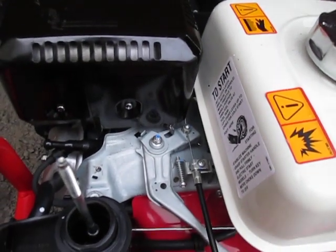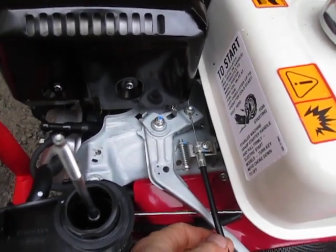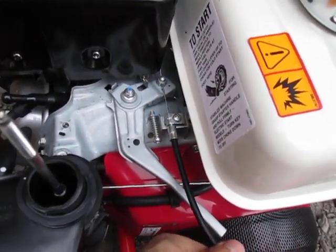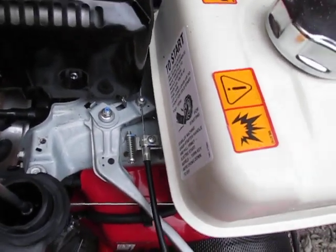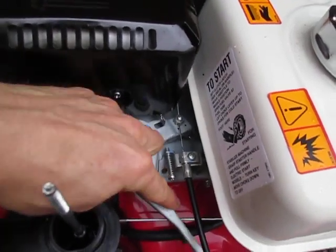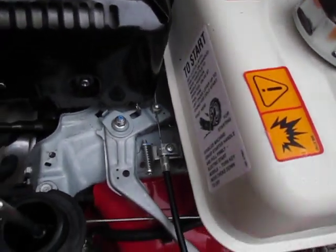So that's the way the system works — it's very simple. What happens often is that your throttle cable will break. They get rusty, they get old, and your throttle cable just breaks. At that point your engine just wants to idle all the time because this spring right here, hidden under the muffler, has pulled it back to idle and there's no cable to pull it up anymore.